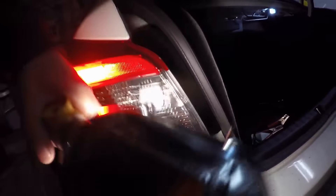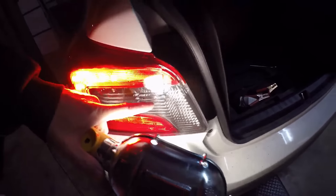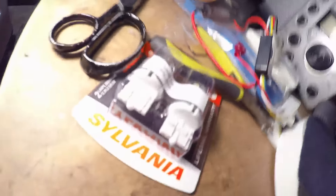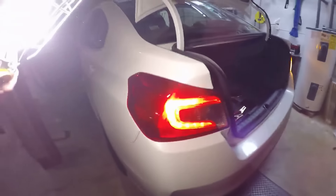I'm gonna finish this up — I'm really stoked. I'm gonna take out my turn signal bulb, which is my JDM turn signal bulb in there. I'll take them out because they are not ever going to be used with this harness. I could tap into that reverse light and throw in these 7443s — I'm pretty sure that's the right one — and put that in the turn signal place, but then I've got to do the T-tap stuff. I'm gonna leave that for tomorrow because I haven't studied it yet and I don't want to mess that up.